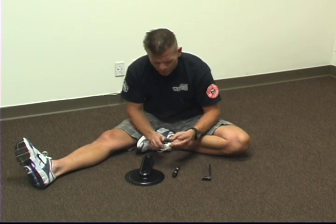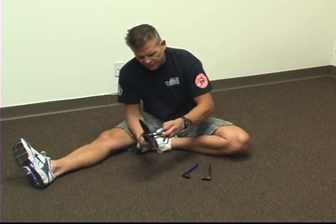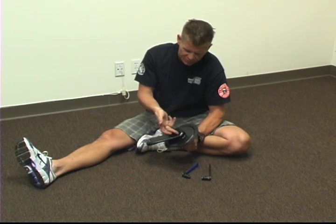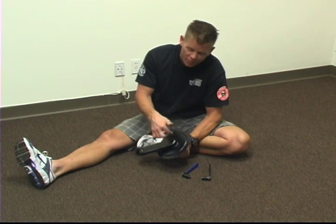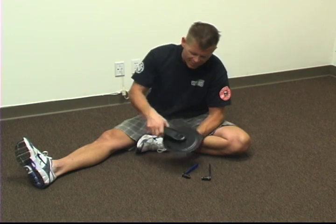But probably the most important part of using a crank tool is that before you can take the crank off of the spindle, you have to remove the bolt from inside the crank. There's usually a dust cover, and that comes out either with the tip of a razor blade or a screwdriver. They twist out. You take the dust cover off, you take the crank bolt out, and then you have the crank and the exposed spindle inside.